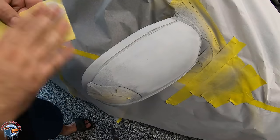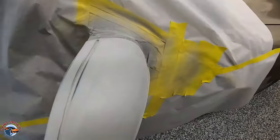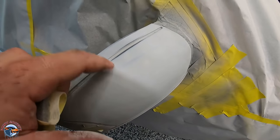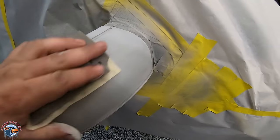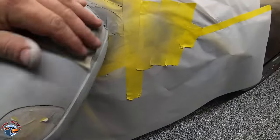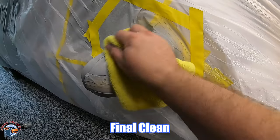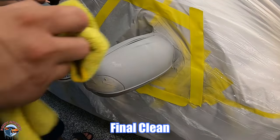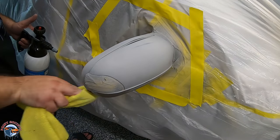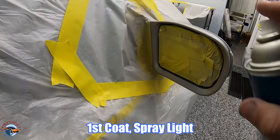You don't need to use water — this paper is designed to cut and that's just what it does. After sanding it's going to look something like this. You might have some burn-throughs; you don't need to reprime those — the base coat will be fine since we're at 800 grit. If it were much coarser, I'd say reprime. Don't worry too much about it. Use a little wax and grease remover with a microfiber to make sure it's nice and clean, and now we're ready to shake up our base coat and get rolling.